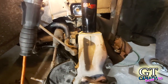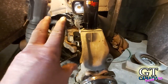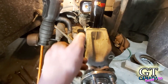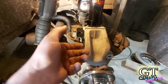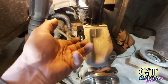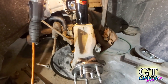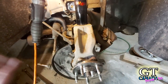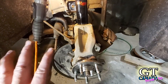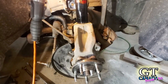Some guys say you're screwed and you'll have to buy a new axle — you shouldn't be, as long as you're willing to give it some patience: pull out, twist, back in, try multiple different positions, hold it at the right angle, line it up as you're popping in, and it'll pop back into place and you'll feel it. This may require two people, so have a friend handy to help. We're at the point now where it's really just putting everything back into position and bolting it all up.